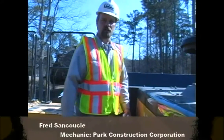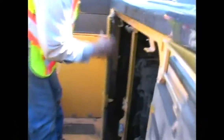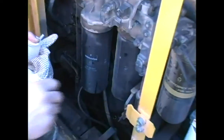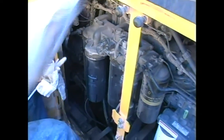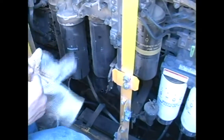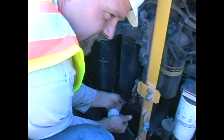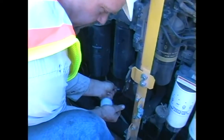This is your engine compartment. Right here is your dipstick — check your engine oil. Pull your dipstick and run your tube into the dipstick tube to pull your sample on your engine oil. The sample tube is approximately as long as your dipstick so that you catch the center of your oil and don't pull off the bottom of the engine and pick up any contaminants.